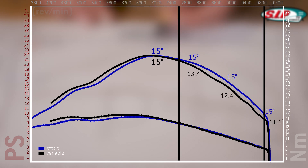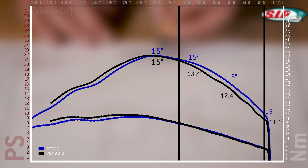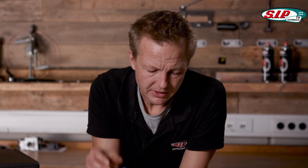At the end of the power graph, the static ignition actually shows a better performance than the variable timed ignition. This is an indicator that we could gain power if we give the cylinder more pre-ignition — maybe turn the ignition base plate to have a spark advance of 18 degrees instead of 15 degrees. The engine will generally become a little warmer, but since I'm only doing short trips and won't be at full throttle all the time, I'm not afraid of a seized piston. Let's try on the dyno if we gain some horsepower by increasing the level of spark advance.